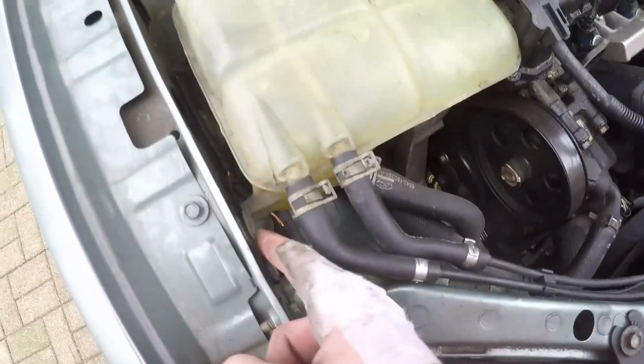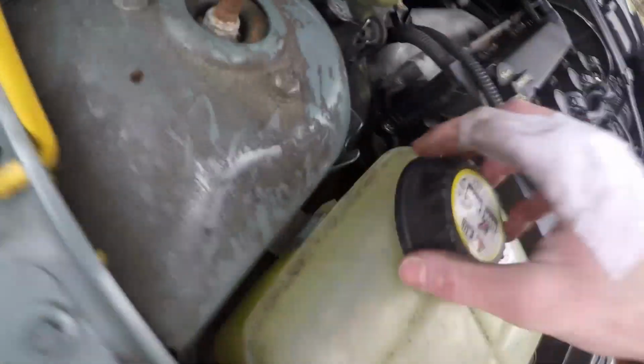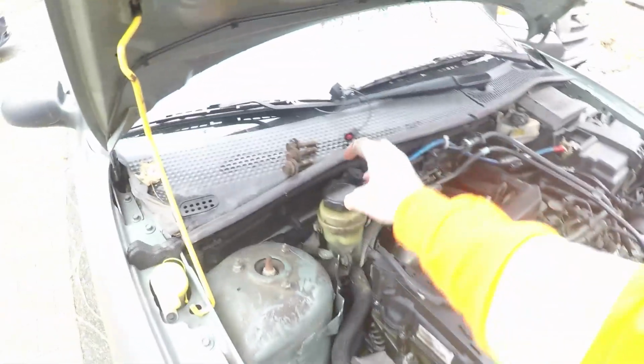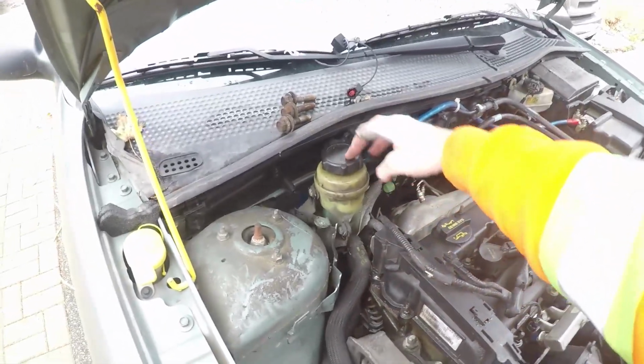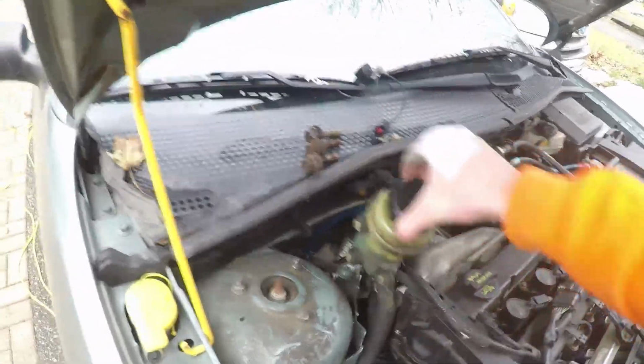There's a bolt just down here at the side. It's pre-removed. I believe it was an 8mm. And then there's a tab at the back here, which makes it pull off. Then it can sit off to the side here. Power steering, there's no bolts holding it on. It just has a snug fit with the rubber grommet. It can pop out and off to the side here.